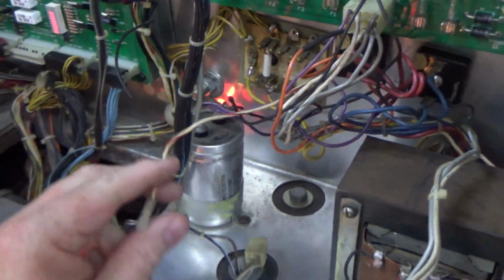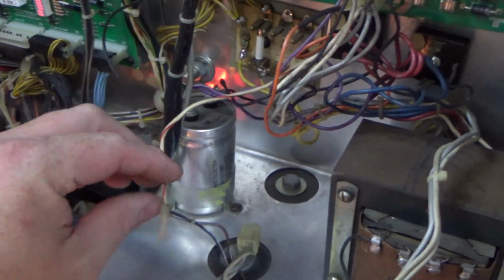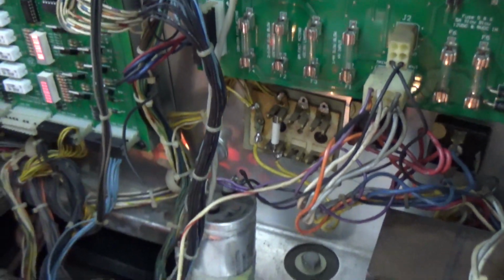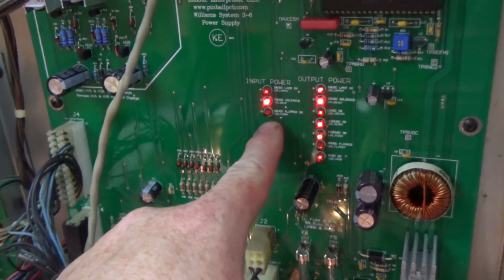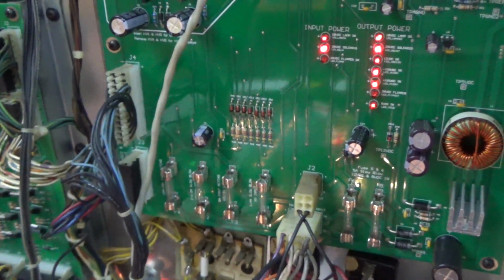era machine. I think this harness might be from a prototype or an early version or a later version or something like that. But for our purposes, basically this line needs to go in pin 3. So I'm going to do that with a brand new connector, and that should get our flipper voltage LED on and our flipper voltage out LED on, and get our power down to the flippers where we need it, as well as run them through a fuse.